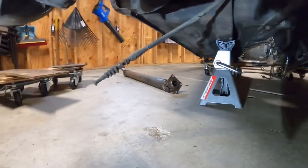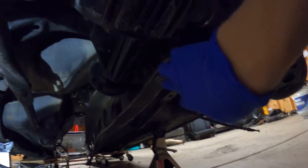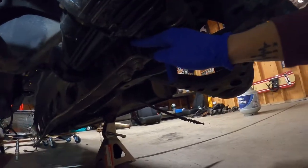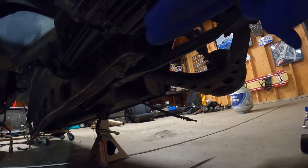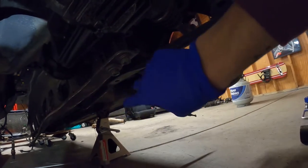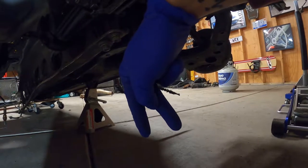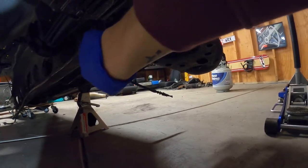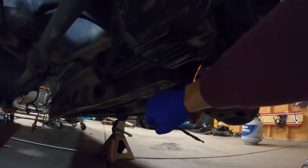This car doesn't obviously have a driveshaft right there, but there's going to be four of them. You can always pull the e-brake out, make sure it's neutral, just rotate it and pull those out. These are very, very long bolts — they actually go in through right here, through the diff. There's a little block on the top of it. What you want to do is undo them, then thread them in a tiny bit, because on the top of that block there are two nuts that are pressed into the holes. You've got to take my word for it — thread them in maybe two or three full turns, then hit them with a hammer so you can knock those nuts out of there.